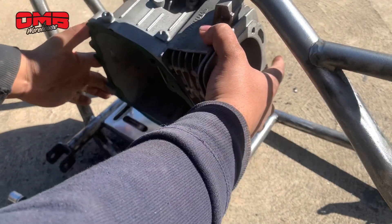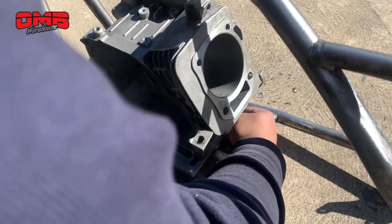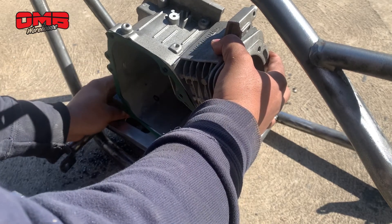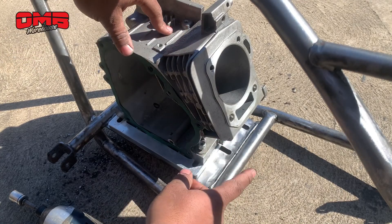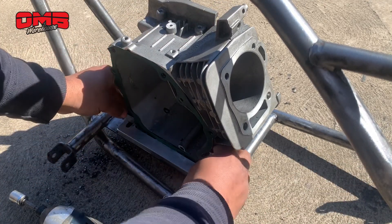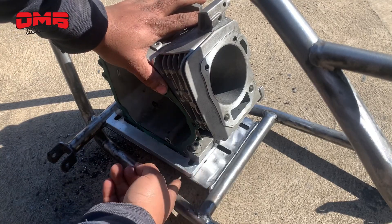Then you want to actually put your engine on, obviously with the clutch on and chain to line up everything. You actually want to put the nuts and the lock washers on, and then you want to line up the chain correctly, and then you want to actually bolt the block to the plate down first, because you want to tighten up the chain — all the way back. Tighten the block to the plate down, and then after you're done with that, tighten up the chain by moving it forward and tying up the bolts and the pin.